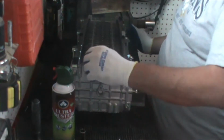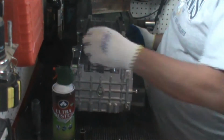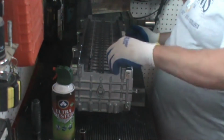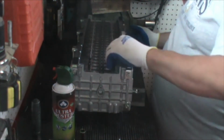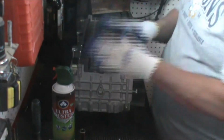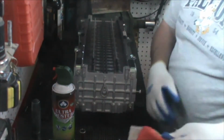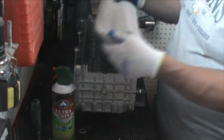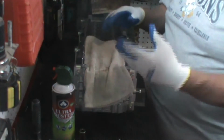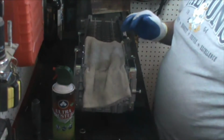We're going to take our little rubber caps and put them on the first 3 posts. Helps if I don't put them on upside down, on each side. In case something were to slip, because we're going to be working primarily in this area about a hand width from the end, we don't want to contact any battery posts and cause a problem. Once we've done that, we're going to take our clean shop towel. This one's cotton. We're just going to lay it in there to provide another layer of safety over those battery posts. That's all there is to getting prepped and set up.